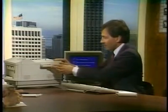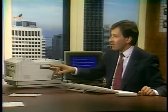Okay. Another significant difference between this and, say, the LaserJet Series 2 is the fact that that slot will also accept personalities, meaning different languages that the printer can understand. So in this case, this is a PostScript cartridge. It's Adobe PostScript, and it sells for $995. But in essence, by putting this cartridge inside the printer, you now have a full-blown PostScript printer. So for the price of the printer plus $995, I have a full PostScript printer that can do anything I need to do on a Macintosh or a PC running PostScript.